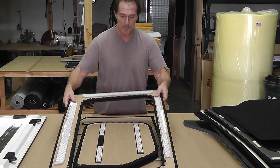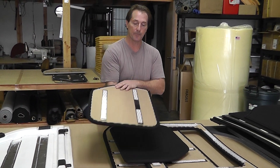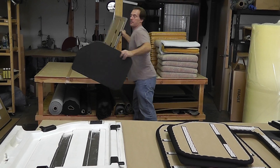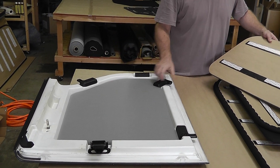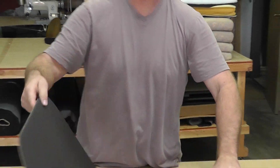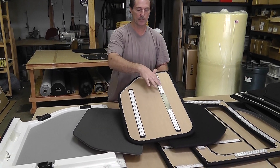Here's a set of our headliners. These are the 2011 to 2014 headliners, so these ones don't fit in here, but I have some other ones I'll show you what they look like. Ours are a headliner board, and then they have foam on it, and then headliner fabric. Here is one put in a different color headliner fabric — it goes in there and all your levers work. Here is the actual headliner panel before the headliner material goes on. It's a headliner board about an eighth inch thick, quarter inch insulating foam — this is a dense foam right here — and then about three-sixteenth inch headliner fabric. It's a soft fabric on a soft foam, and that goes over it and gets stapled around the back. These strips are what the 3M hooks to.